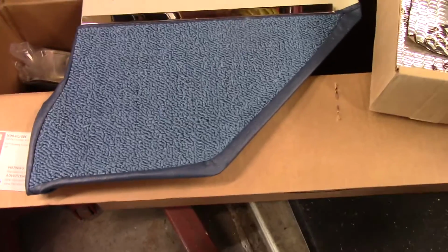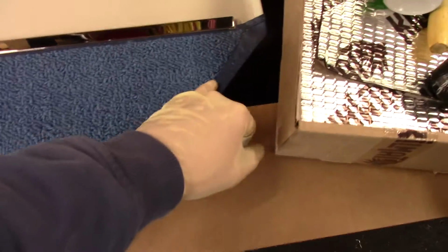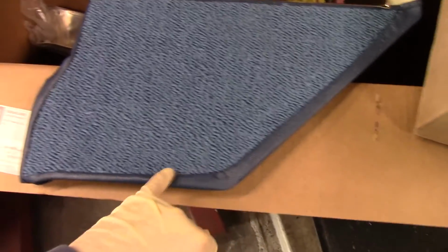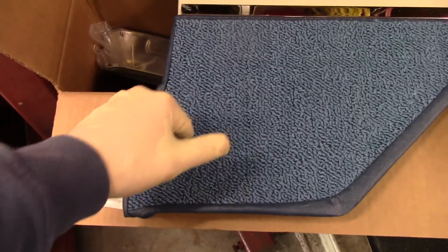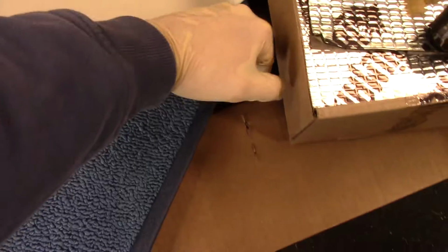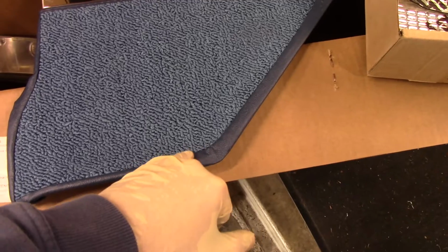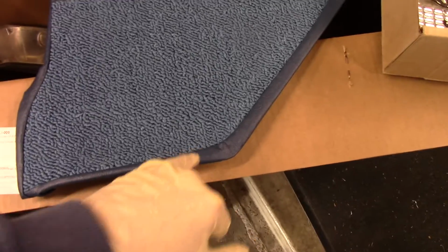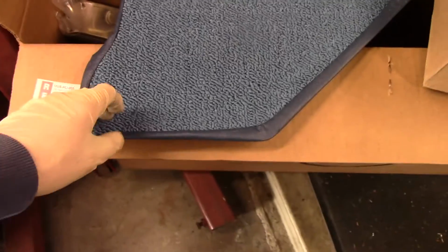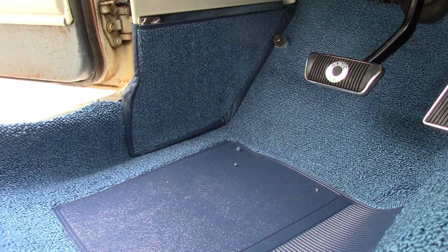One of the things I did notice is the acetone in the contact cement started attacking this. So I didn't quite put it on as heavily on the second one. It's drying right now, getting ready to put together. But it will go away. It had bubbled up quite a bit, but as the acetone dries out, it shrinks back down. So don't let that bother you too much. But I slathered it on here because I wanted a real good bond, and I think it permeated through. So I went a little bit lighter, just put a light coat of contact cement around this. So just a little lesson learned there, but otherwise it came out pretty good. All right, kick panels are in.